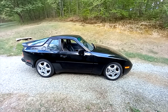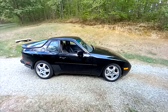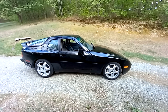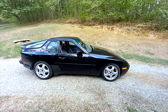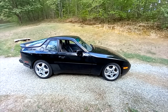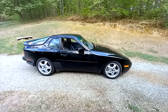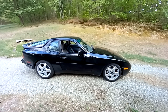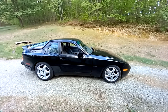So I thought of another thing you could probably do to play with that, and that is to adjust the fuel pressure — which I never really thought of adjusting before, because you usually just set it at 60 psi and it takes care of everything itself. Well, this morning I backed it down to 50 psi, and all of a sudden at idle it stays right in the mid-14s all the time.